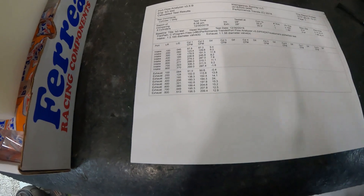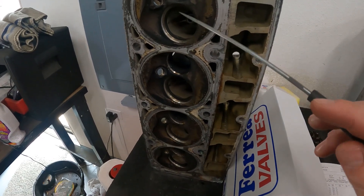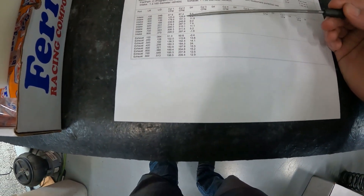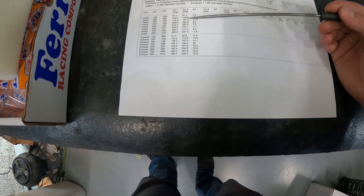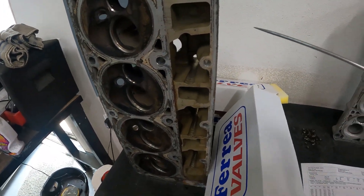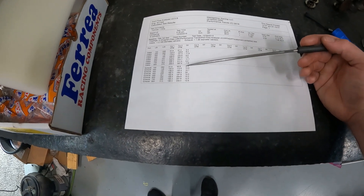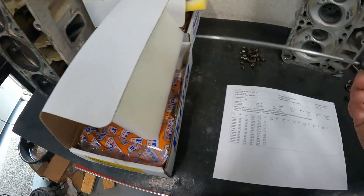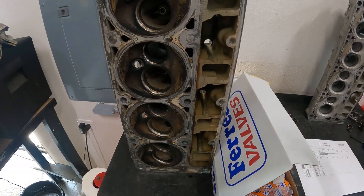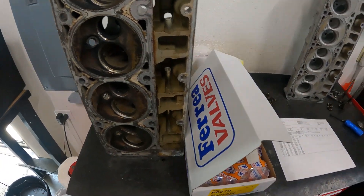Now you might say, why did you even do this video? Because a lot of people will pull an engine out of the junkyard and their head will look like this. They'll tell their cam manufacturer flow numbers — which, by the way, these are pretty low — their flow numbers for a stock head. Well, your head might be a stock head, but with the carbon it's not flowing what it should. So if you're a cam manufacturer really looking at flow numbers to figure out a cam, and your numbers are less than what your stock heads really should flow... a lot of people are straight up getting these out of the junkyard, nothing wrong with that, but a lot of guys don't want to spend the money on LS heads or doing anything really — besides put a turbo on it — and don't realize how much they've left on the table by not doing anything to the heads at all. Easy gain here.